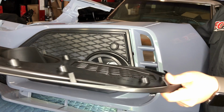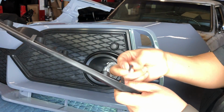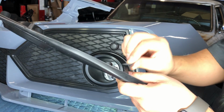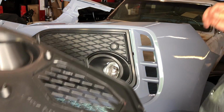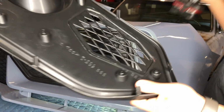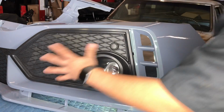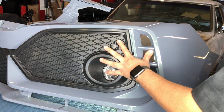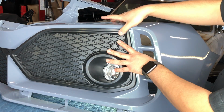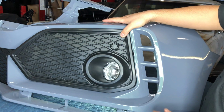instead of trying to do it with the screw, just in case the screw's a tight fit or if it starts going in and then slips one way or another. That way it'll just go in easier. I'm gonna use a drill bit and drill the hole as a pilot hole and then put the screw. Same thing on both sides. Once I get it lined up, I'm gonna have somebody else come hold this side, or I could try adding 1 or 2 screws to hold this piece for now while I line up the other end.